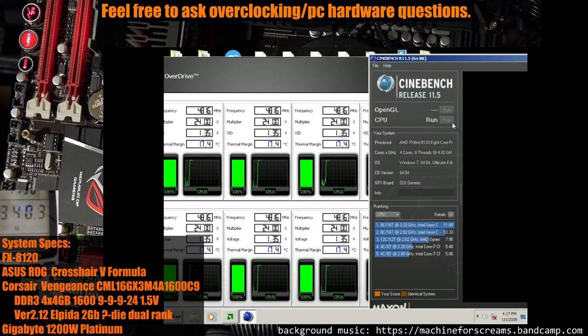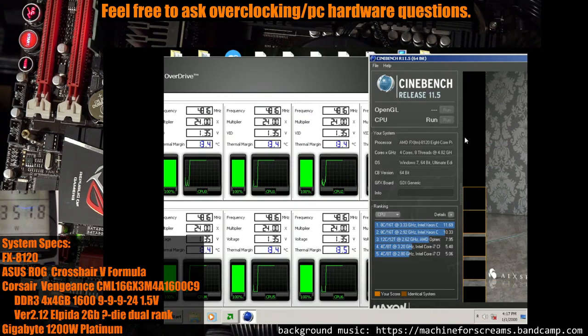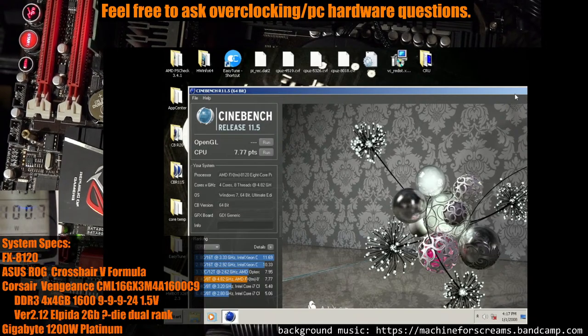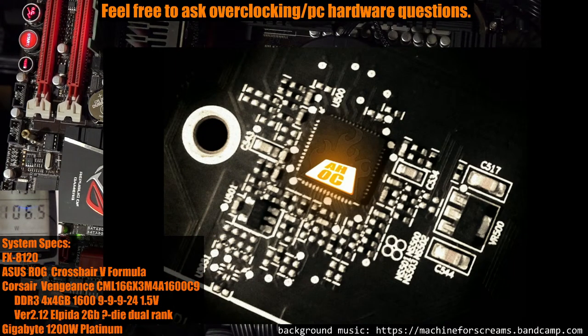Yeah, we still have thermal margins, so I don't know why it crashed that other time. I mean, it might crash again. As far as I know, when you use the M.2 PCIe cards, the board needs to be compatible with booting from PCIe. And on platforms this old, I think you need a BIOS mod, potentially. Ran this time. Interesting. I didn't catch what the blue screen said last time, so maybe it wasn't the CPU.